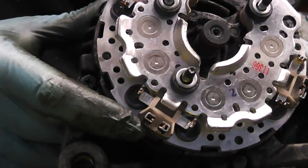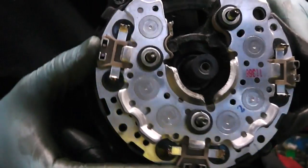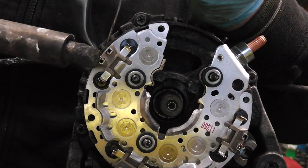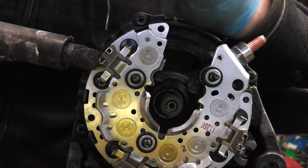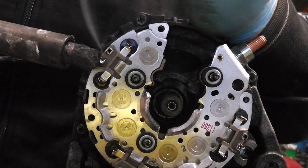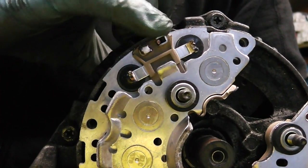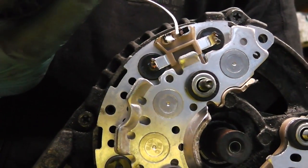Once fitted, you can see the wires we cut coming out through the holes. All you have to do is give them a shot of solder. When soldering, always make sure you heat it up nicely so the solder flows into the connection. Solder all three pairs. One important thing: make sure the two little connections per pair are not joined together — they still have to be separate. Sometimes a blob of solder bridges them and if that happens the alternator won't charge.